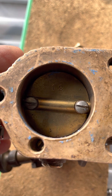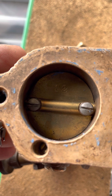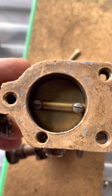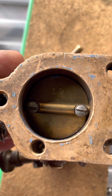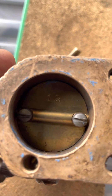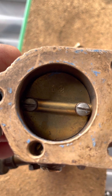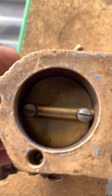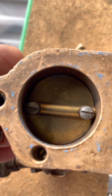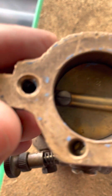If you leave the disc loose and then tighten up the screws, the disc will not meet the carburettor body opening neatly — you will have a gap. That gap will cause tuning problems. So leave these two screws loose, firmly close the throttle valve so the throttle disc finds its mated position automatically, and then commence to tighten the two screws.